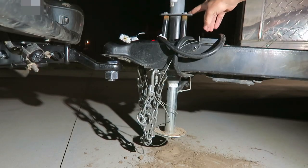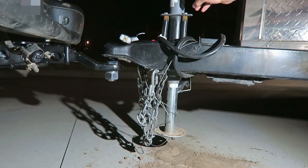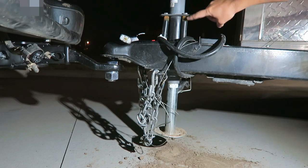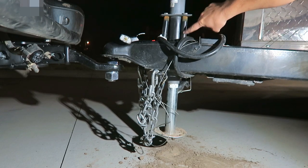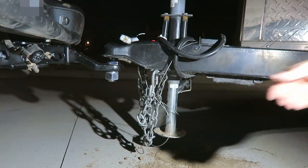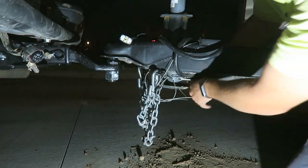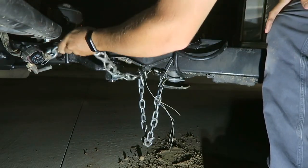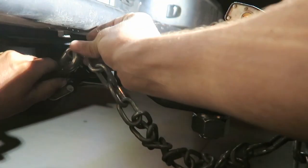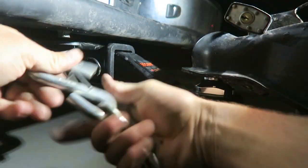This is my upgraded trailer drop hitch. I've actually found a new solution for this I'm gonna do a new video on, but this has been working the way I've got it. I've got this jack extended up on 4-inch pipe nipples, just to elevate that above so that the bottom of the jack is tucked up underneath there. So I can pull this up tight. This is what I was worried about. This is really hard to get over here, but it works.